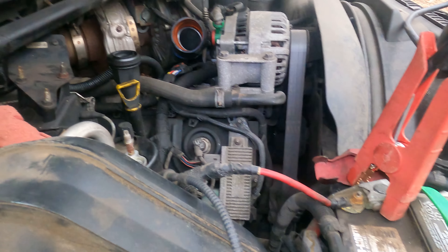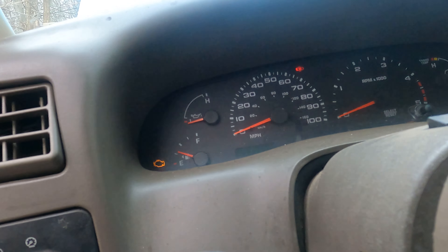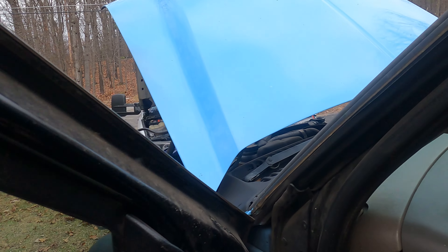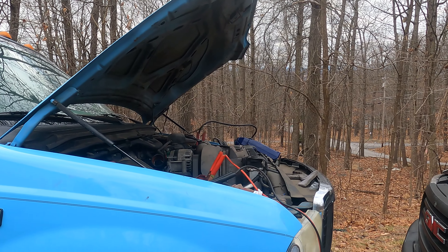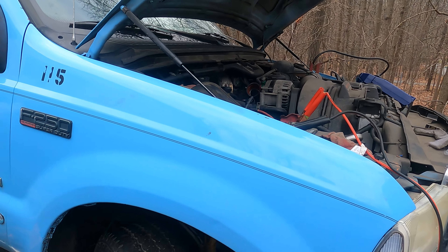Still nothing, which isn't exactly promising. Just because, let's try putting a key in — same glow plug light. It's saying it's too weak. We're trying again; I hooked up my truck to the passenger battery and the jump pack to the driver side. Nope. That was just to verify it wasn't a lack of power from the jump pack — hooked up to my diesel and it's still not starting. I also tried going straight from the starter cable, same results.